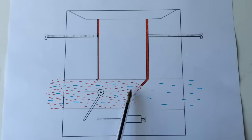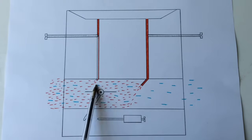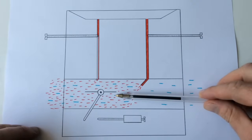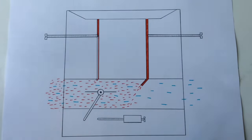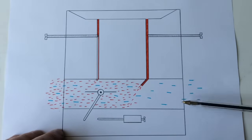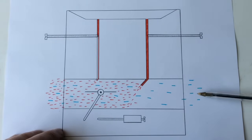...and it's allowed a lot of fuel to come through - way too much. You can see there the ratio is not good: you've got much less air than you have fuel. What's happened is the engine can't cope with this amount of fuel and it will be really lagging, so it won't be working at its full capacity.